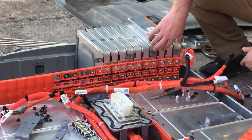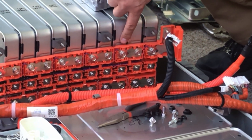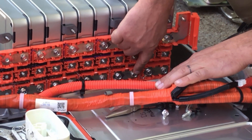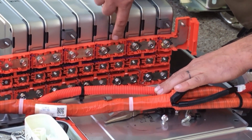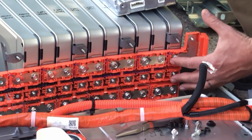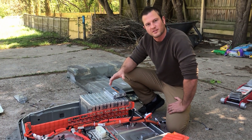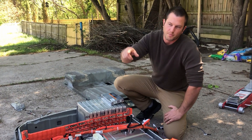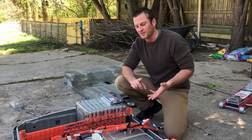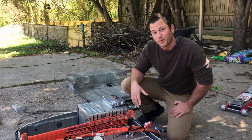The way they have every battery in this pack connected — you can see it goes from the positive on this battery to the negative one here, and if you'll zoom that in a little bit — it goes through this battery, from the negative there to the positive there, and through that battery. Each one of these batteries is two cells at 3.7 volts, and they just string them together until they get to the 400 volts necessary to run the big motors. It's the same way in every electric vehicle — a Chevy Bolt, a Tesla, a Nissan Leaf — they all just stack these little 3.7-volt cells on top of each other until they get to the 400 volts they need to run the car.